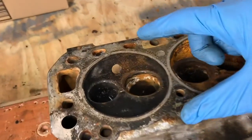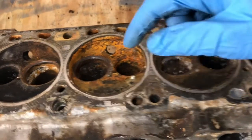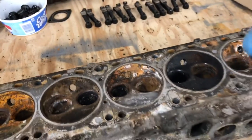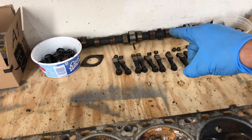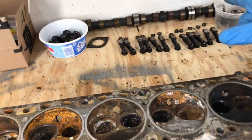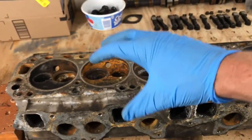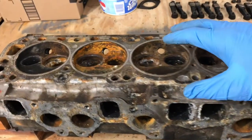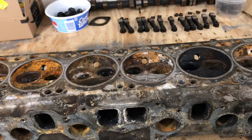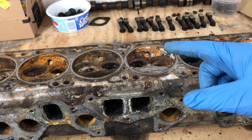So we've torn apart the head, got all the valves out, everything laid out. Taking a further inspection — obviously this thing needs to be cleaned, but you can see these seats are going to need to be replaced. The valve guides are probably going to need replacing too, along with new valves, and definitely a porting and polishing would be needed. In the case where we might be regrinding the camshaft, you'd also want to resurface the rocker arms and check the cam for runout and any issues with the cam towers. We kind of knew this head might not be usable or would need a lot of work. We were told the other head is in better condition, so before we send this head off to the machine shop, we're going to pull the other head off the spare motor and see what condition it's in, then go with the best one.